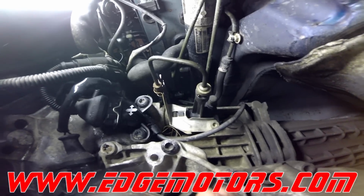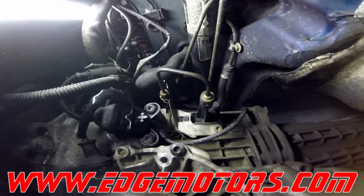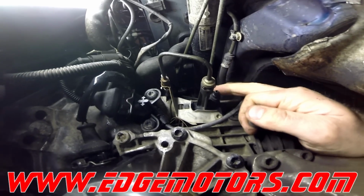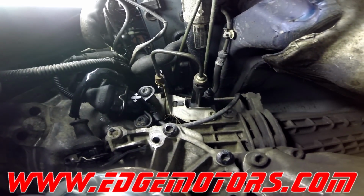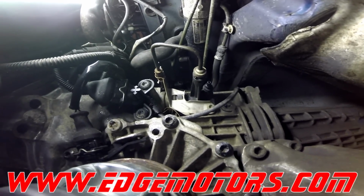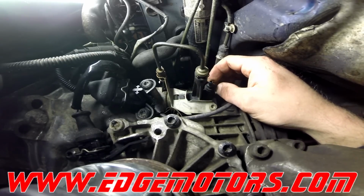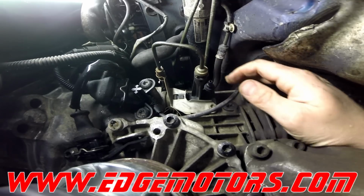So here's the clutch slave cylinder, and over here this is the bleeder valve. This is where we're gonna bleed the clutch system. Be careful with the bleeder. In a lot of Audis, the cylinder and the bleeder are made of plastic, so you definitely don't want to strip it or break it, then you're gonna need a new one.